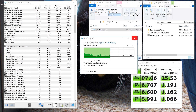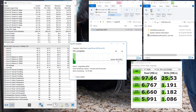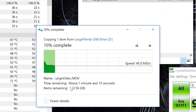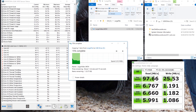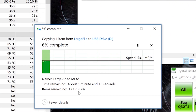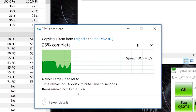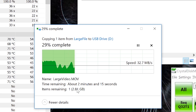There's a little bit of consistency with this performance hit. If I cancel this copy and simply recopy again, you'll notice this thing starts right off at the same performance up there in the 40s and 50s, and it's going to drop down right when we hit about 500 megabytes. Let me wait after I stop here for just a couple seconds - let the drive settle. I knew it settled by watching the lights on the drive, and we're at the 50 which is the original average, and right when we get here it's going to start dropping down. That really seems to indicate to me that there is some caching and it hits a bottleneck that it normally wouldn't hit when we copy a file that's about 500 megabytes or less.